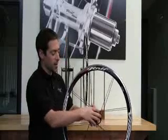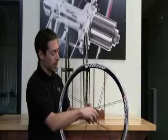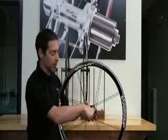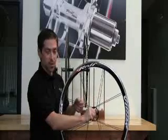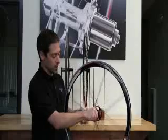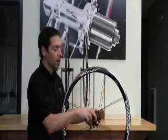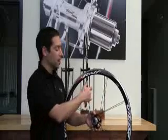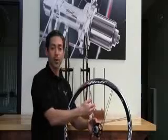As this wheel is rotating, you have pulling spokes — and when I say pulling, it's because they're pulling tangent, pulling the rim around. On the non-drive side, you have pulling spokes too. But to make the non-drive spokes pull, they actually have to transmit that torque across the hub body.